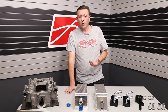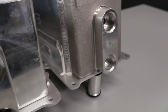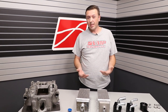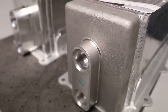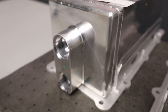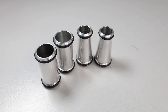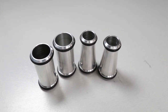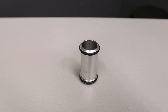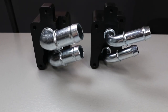I just talked a lot about airflow. We also wanted to address water flow with our intercooler core upgrade. The amount of water that you can get through the core is ultimately going to determine how much heat it can pull out of the air. We wanted this core to be a high-performance stock replacement because, given the age of these cars, the factory cores are failing and leaking. If you accidentally had water in the system and you're up north where it freezes in the winter, you may have exploded one. So we have made this core upgrade very flexible. We make size change tubes that allow you to install this core with the stock water manifold, so you can do just the internal upgrades if you're forced to because you've got to upgrade a failing piece, and you can do the high-flow VMP water manifold later on.